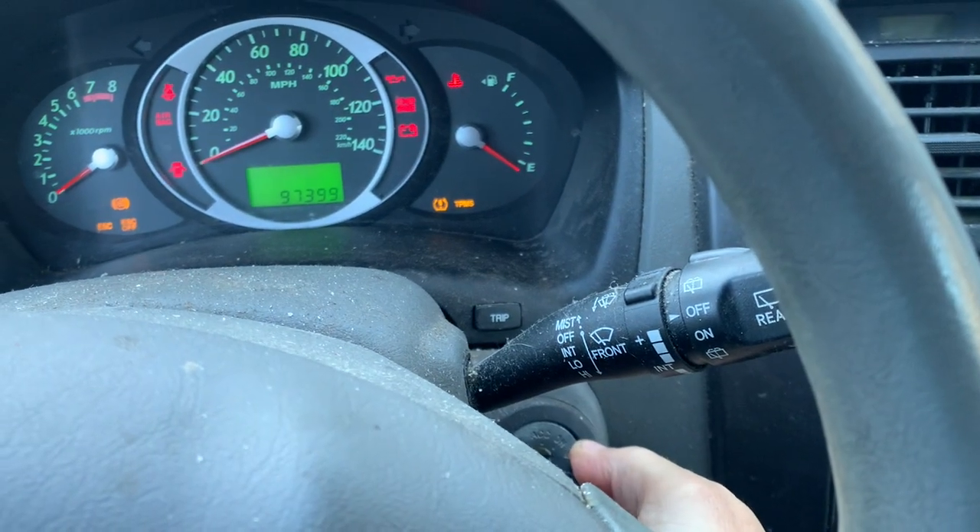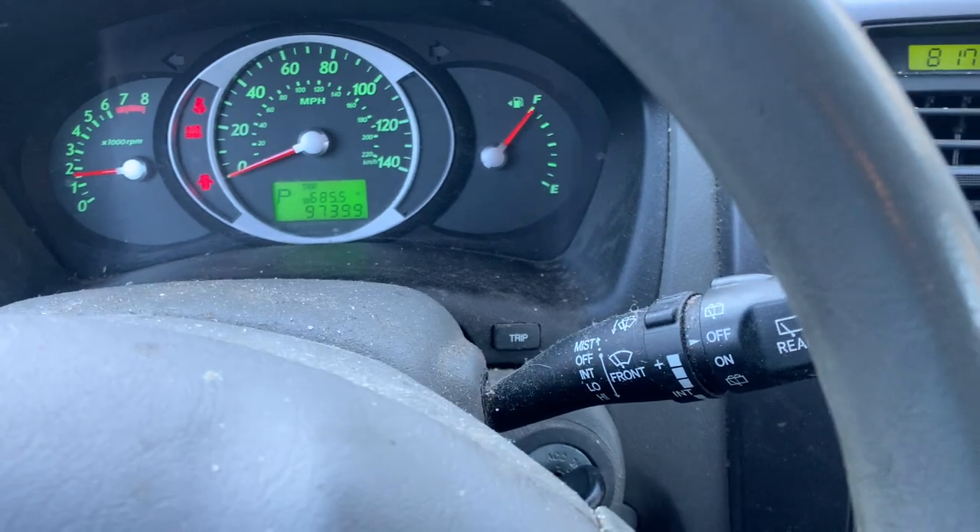The real challenge on a day like this is trying to start the car. The steering wheel would barely work for a bit. The car has a funny wobble because the tires freeze a little bit flat on the bottom — the air shrinks in the cold temperature, tires get a tiny flat spot, and when you drive it's like bubble, bubble, bubble.